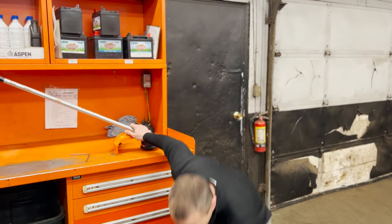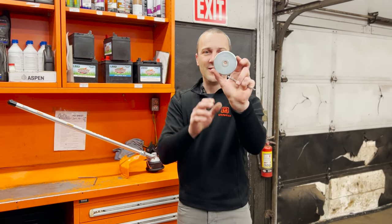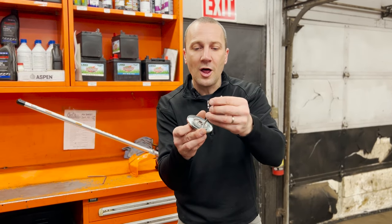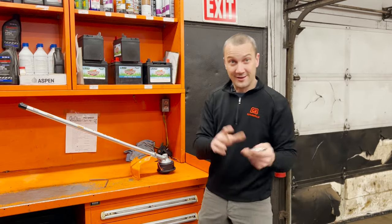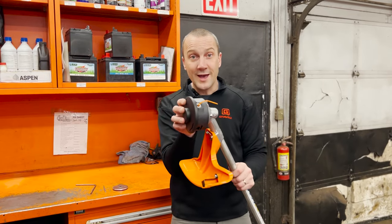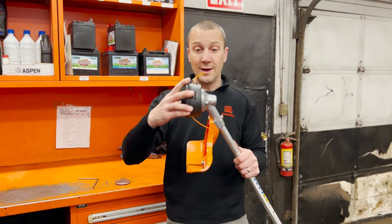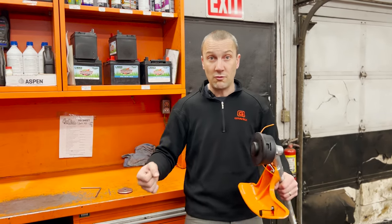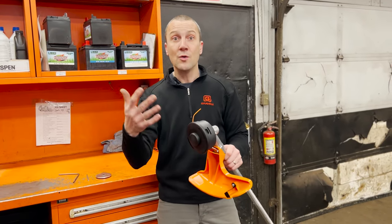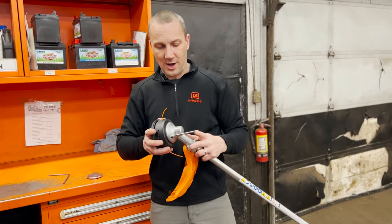You want to know why? Did you hear that noise? Maybe if you're out in the grass and the lawn, you probably didn't hear that noise when it hit the ground. This sucker right here — the thrust plate is out. So no longer do I have this locking tab that allows me to take the head off. This also acts as a bearing between the head and the gearbox. So what's going to happen is I'm going to fire this baby up and try to run it, and it's going to tighten up and be jammed. The engine can't overcome the load, so you're going to go to take the trimmer head off and it won't come off because there's nothing to lock into.